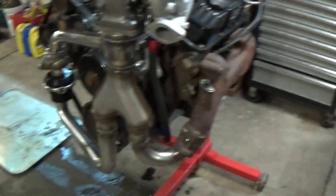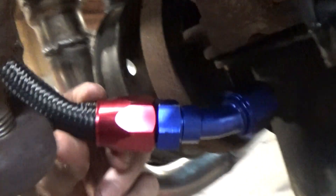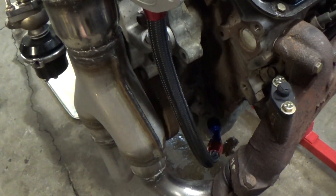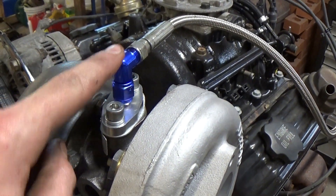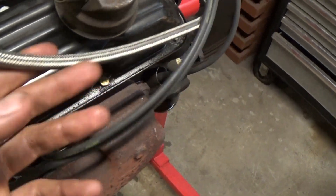I am really tired — I have been at this thing literally all day — but I got almost everything finished. I'm going to end the video here and in the next video I'll continue with the rest of the stuff, but I think this is a pretty good stopping point. I got the bung welded onto the oil pan right there on the corner. I need to get a 90-degree AN fitting here, but for now hopefully this one will work — there's a little kink in it, but just for now that'll hopefully do the job. I've got the feed line on as well.